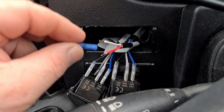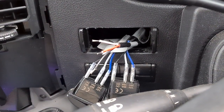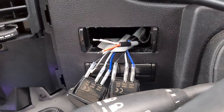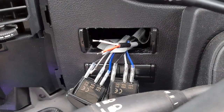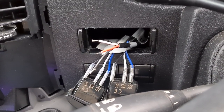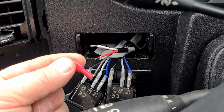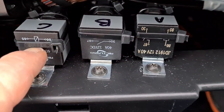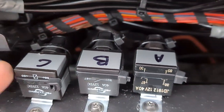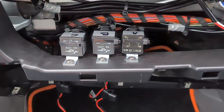I attempted to fit some blue crimps onto these small switch wires — these run from the relay so they don't need to be that heavy. In reality I needed red ones, but I tried the blue ones and when I belled the cables out before putting everything back together, it didn't work. So I wasted my time when I really should have just gone with the red ones in the beginning — do the job right. We put a cable tie round and it pulls on the back of the joint, then we just wrap another cable tie round to pull everything in place and stop loose connections. Might be overkill but it works.